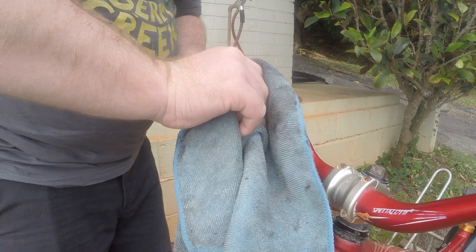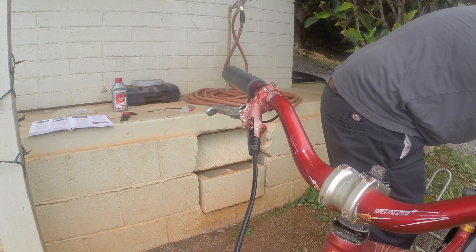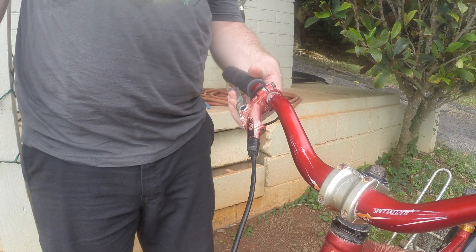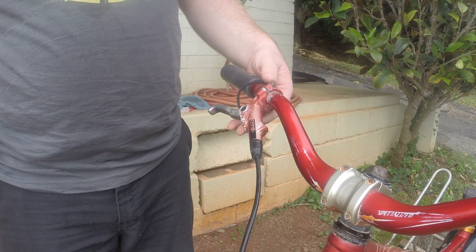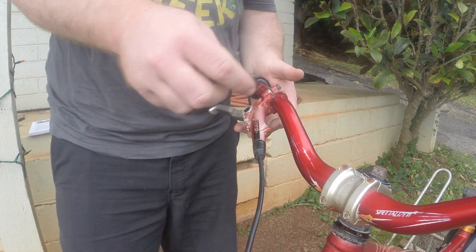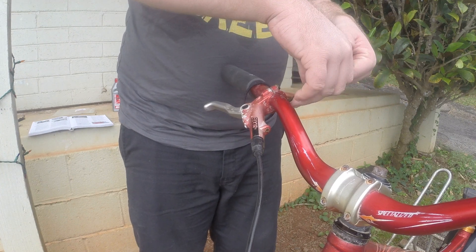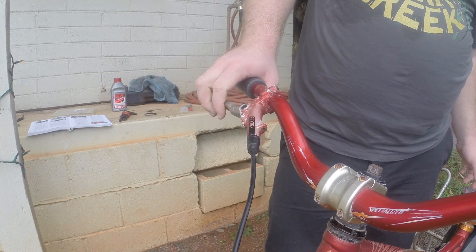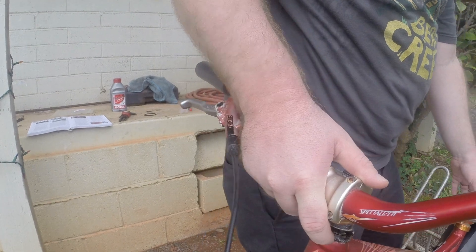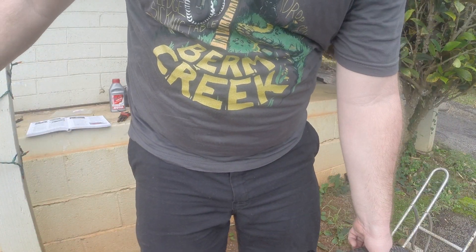Got all that set — make sure you wipe down around the lever and your caliper. Brake fluid will eat away at your paint if you have nice stuff. I think it's actually my pads — it feels better, but I think it's actually my pads that are the issue. Let's wiggle this lever back into place, get back into your normal riding position — which for me is right about there — and tighten up your bolts. So you got your lever all set, it does feel better, but I think it's actually my pads that had an issue. Make sure you check before you go through with bleeding your brakes that your pads aren't just worn out — that there's actually still pad material left.